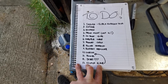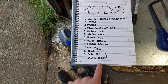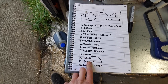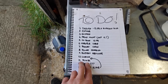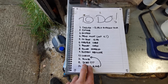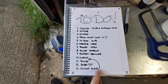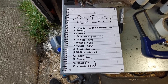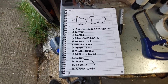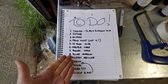Before those I need to do the clutch slave — I need to whip the one out of the Celica, because it routes around the six-speed box whereas the Yaris one does not, so I need to swap them over. Then I'll need bleeding as part of the fluids change — oil for gearbox and engine, coolant, not power steering, and the clutch. Once all that's done I'll turn the key, and then all these question marks will come into play. Probably it won't start, then we can start poking around trying to work out why that OEM ECU is unhappy that I've disconnected 50% of its inputs and outputs.